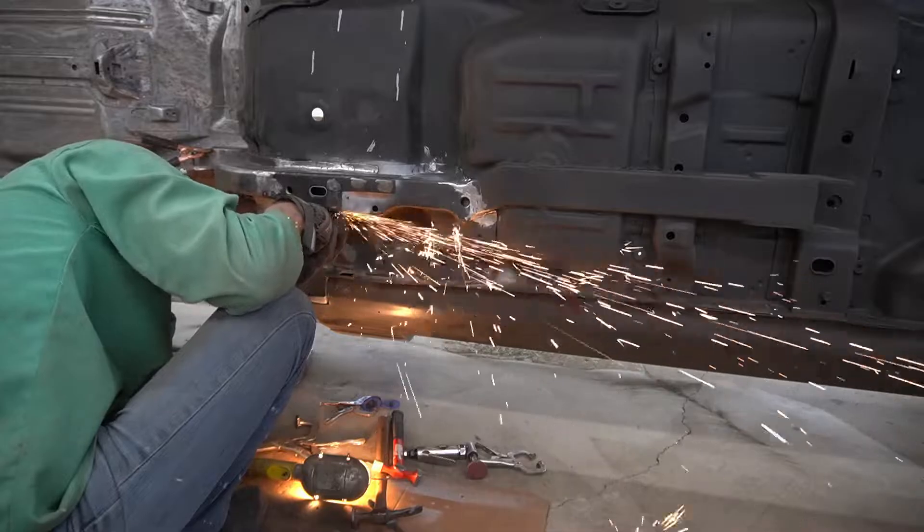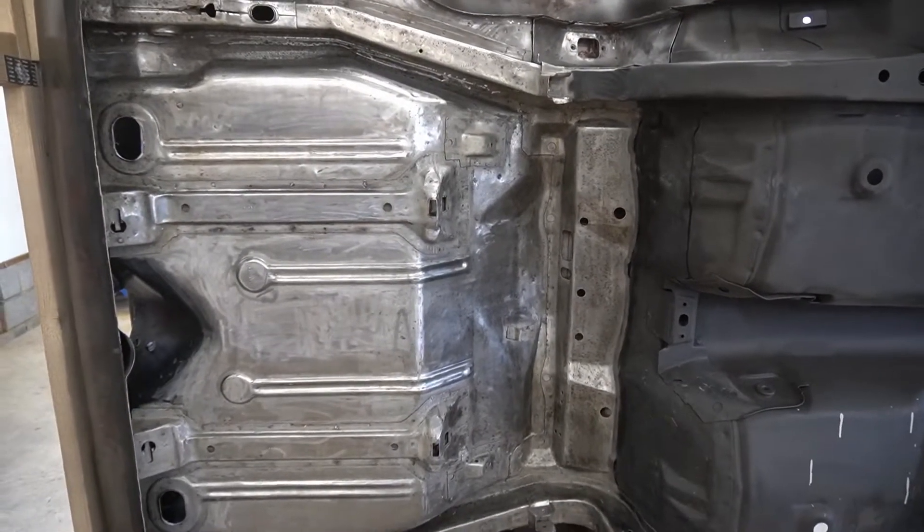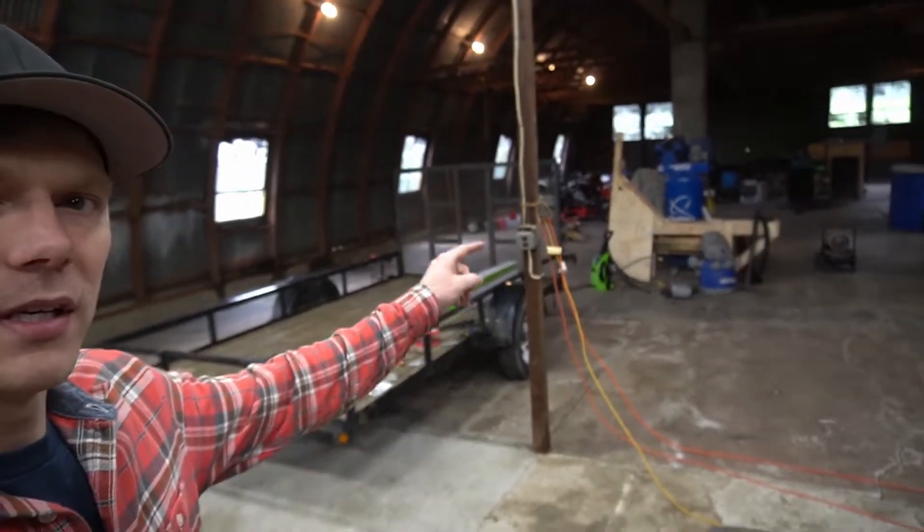Quick update on the car: I did finish the driver's side torque box — I filmed a good bit of it but decided not to post it since it was so similar to the other side. I also got the back half of the car underneath stripped down and epoxy primed. What's left underneath the car is some plug welds that need cleaned up where I welded the wheelhouses and tailpan together — even though it's underneath and you'll never see it, I still want to clean it up and make it look good. Then I need to weld the e-brake brackets back onto the car, and once that's done I'm going to raptor line the underside. I have all that stuff purchased and ready to go. Next time the lights will be done and I'll be underway with the air compressor and welder, and then we'll put the tip-over jigs back on the car and flip it up to get back to work.